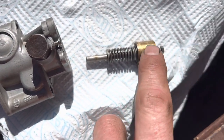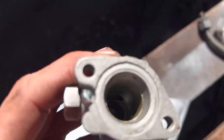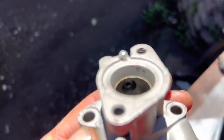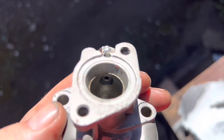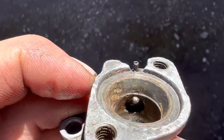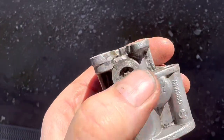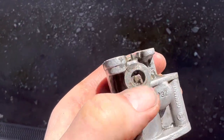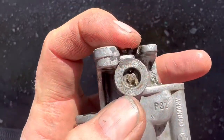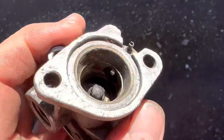You can push this piston all the way out — it's just a piston with a spring. You can lube it with a little bit of silicone grease. On some of these units there's no cam, but the one we took from the car has a little bulbous piece of metal that turns when you turn this nut — which is obviously sheared off — and is held in place by a pin that stops the piston coming out.